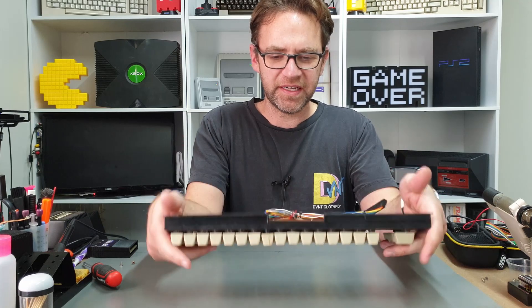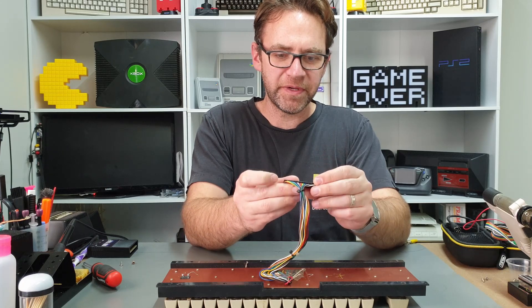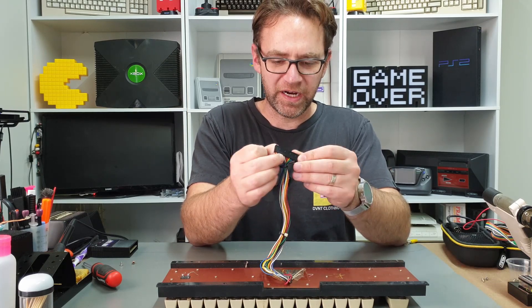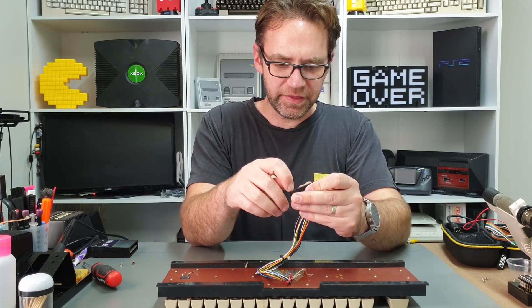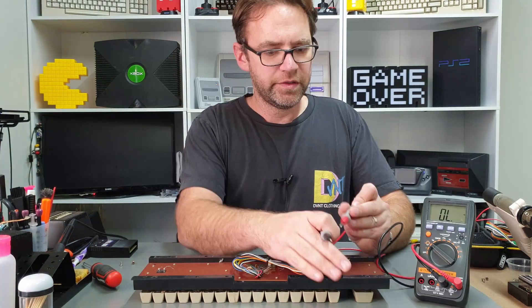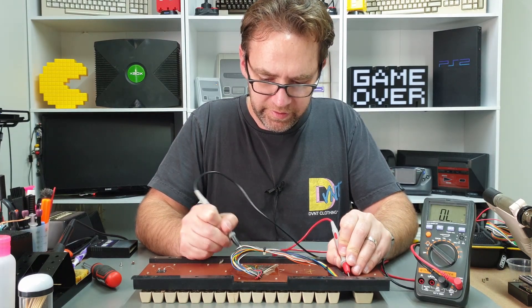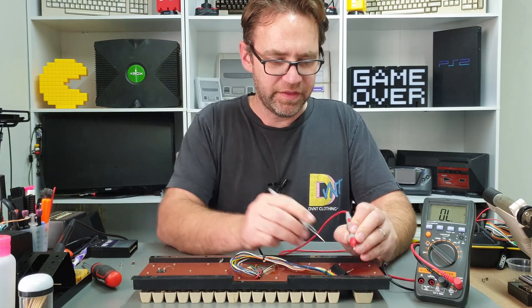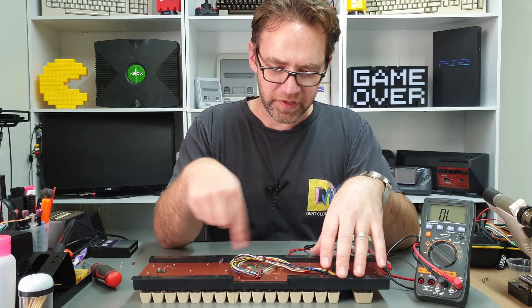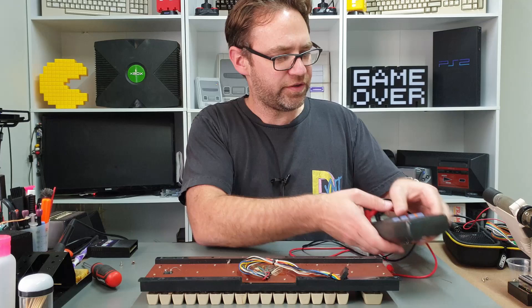We'll take a look inside just to see if the wire — which I think is pin 18 — is making good contact with the main board and the keyboard. If that checks out then we'll pull the keyboard PCB off and have a closer look. Here's our keyboard just by itself. Looking at the connector, pin 2 is blanked out so we know that's pin 1, and it's a 20-pin connector, so pin 18 is going to be the green wire. I'm going to test from this end of the plug to where it goes into the PCB to make sure this wire is intact. The connection from the plug going into the PCB is good.